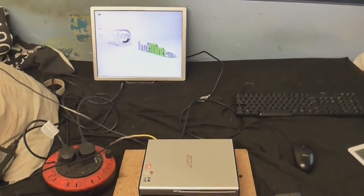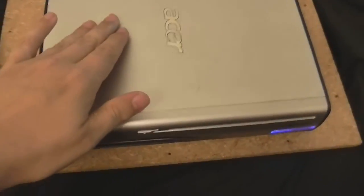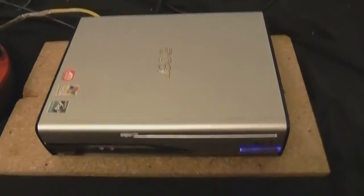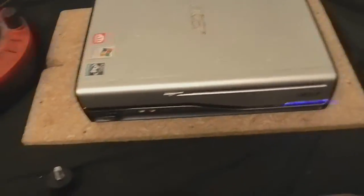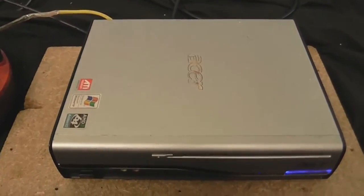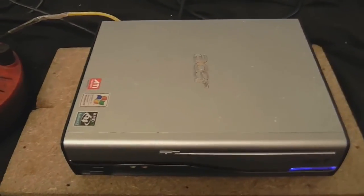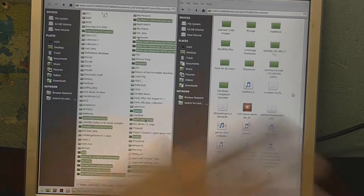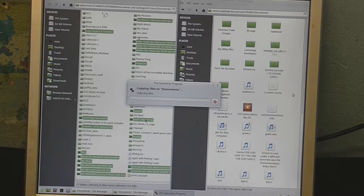I've got a very nice clear picture on the monitor. The first thing I want to do — because I've got a lot of files on the hard drive that I want to save before I reinstall Windows on here — I'm running a Linux Mint Live CD at the moment. So I'm going to transfer all those files I want to keep onto this computer. I've got my other computer up here, viewing it over the network, and this computer's hard drive on the left. I'll just drag those files over to there. That'll make things a lot more simple than having to take the hard drive out and do all that faffing around with it.